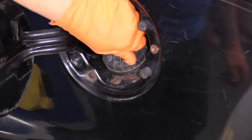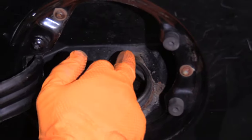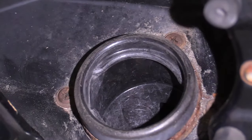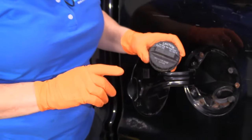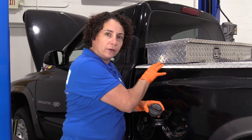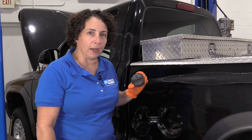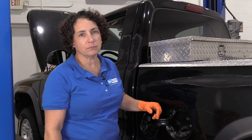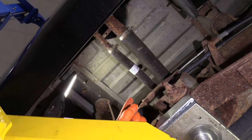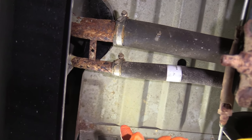Check the gas cap, make sure it's on tight. You want to check the rubber seal — make sure there's no dry rot or cracks — and don't forget the filler neck. These rot sometimes, and you'll find big piles of rust on them, and when that happens it won't make a seal. Also, someone might have put an aftermarket gas cap on. Some of them work, some don't — it all depends on the vehicle. I've had many come back with an aftermarket cap, and the code kept coming back. Got the factory cap, and the code went away. Don't forget to check your filler hoses — those can corrode — and a rusted filler neck will more than likely cause a leak.